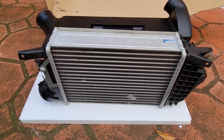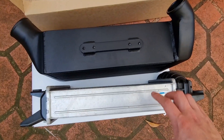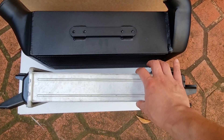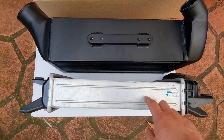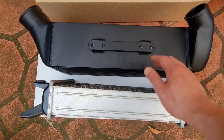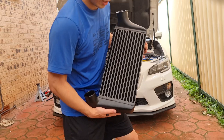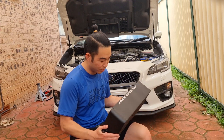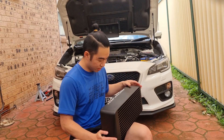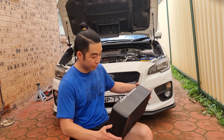This is probably why I am having issues. The surface area is so much smaller than this one, and the volume of air it can hold is so much smaller than the verticooler, so it soaks up heat a lot more quickly in the engine bay. Now this thing is absolutely huge, it's so substantial. Quality, quality stuff. Let's get this in the car.